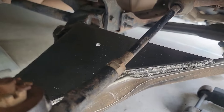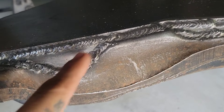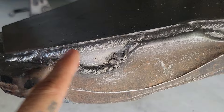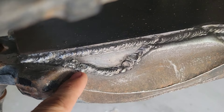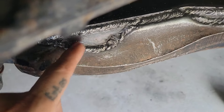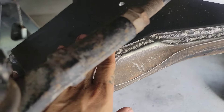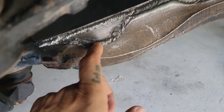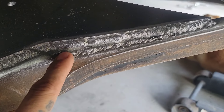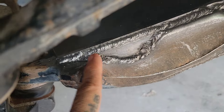Let's take a look at the metal I welded onto the lower control arm. Right here I added this little plate - it's welded not only from the outside of the control arm but also from the inside. I tack-welded the pieces together, then took off the top plate, welded the whole inside, put the top plate back, and welded everything together. There's a small filler piece over here as well.